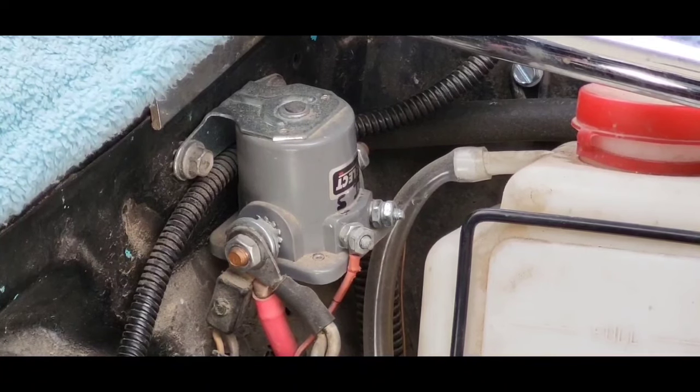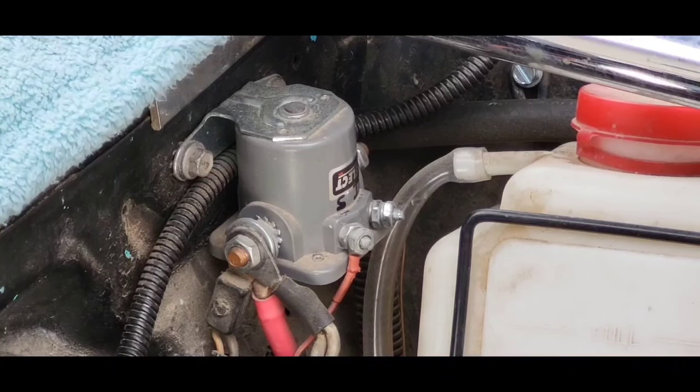I don't know how many times you hear of it, but every year people are crushed between the car and their bench. They'll pull it into the shop up to the bench and either the neutral safety switch is not working properly or they didn't check. This is a cold fire up, so it's going to be revving at between 1,500 and 1,800 RPM. You can imagine if that caught and the thing was in gear. If you're standing in front of it, you're going to be a hurting unit. So you never cut corners when you're dealing with a remote starting switch.